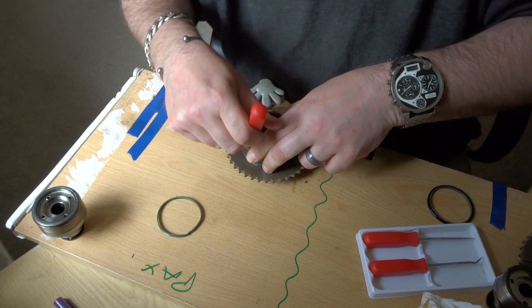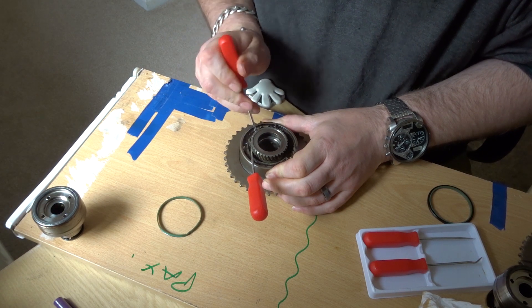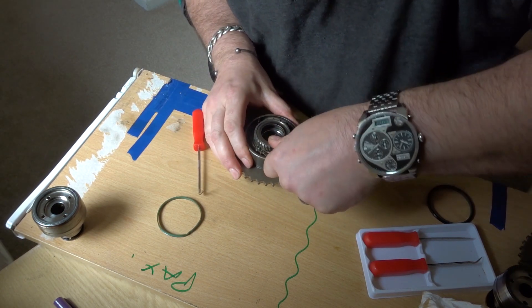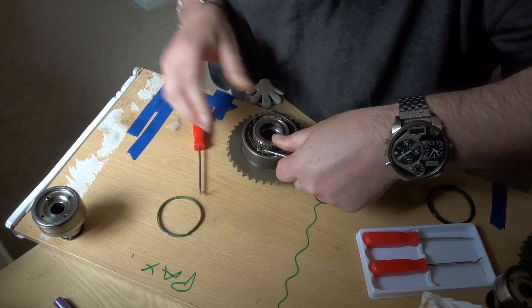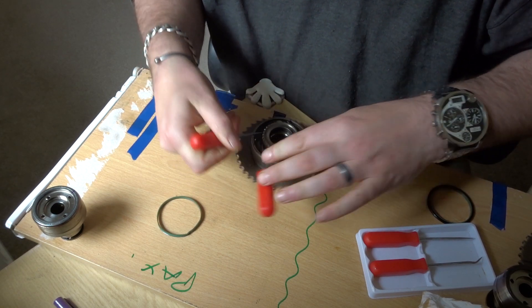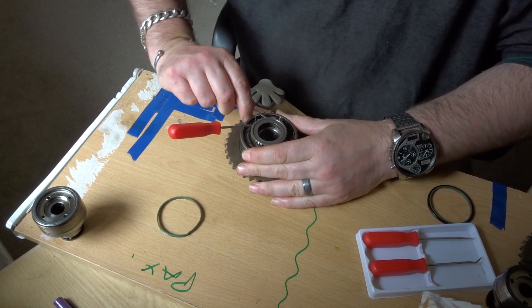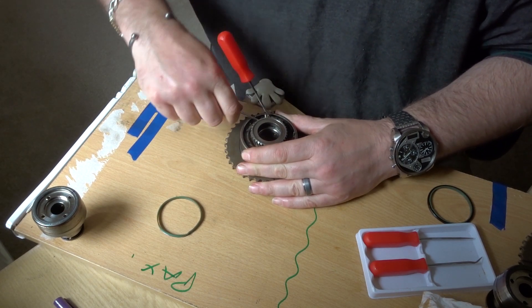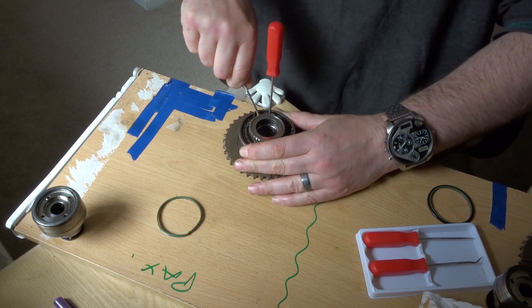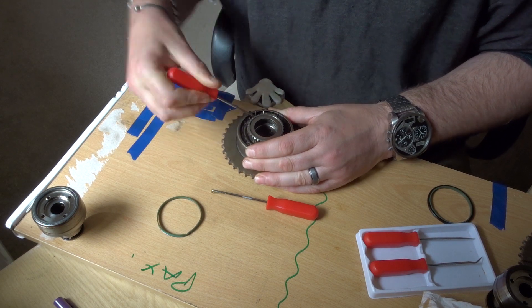BSAN do say don't go nuts with screwdrivers — you'll crack the plastic housing on the VANOS. But using a good bit of force you can lever it out. After a few minutes of trying to get this O-ring out, I did get annoyed and just snapped the O-ring in two using the pick, then just pulled it out like a piece of string. The other side I did manage to get out in one piece, but this one was being a little tight, so you'll see very shortly I lose my rag and just tear it out.